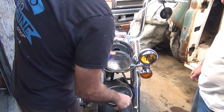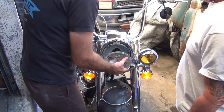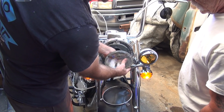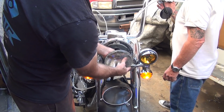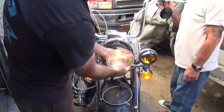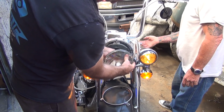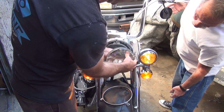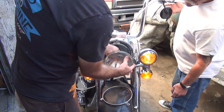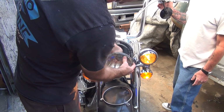Maybe it's just. Okay, what's your headlight? Is it on? Yeah. Spotlights aren't on, so you're not on low beam. You're not on anything. There's high beam. Okay, where's low beam? These aren't on again. Well, they are. Let's get them on. Okay, low beam is not working. Okay, turn the spots off.